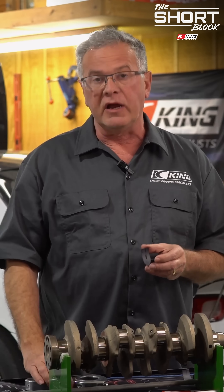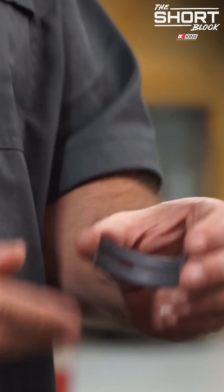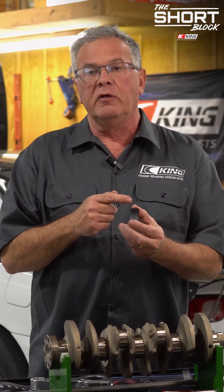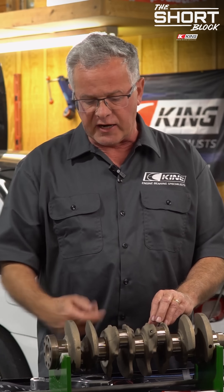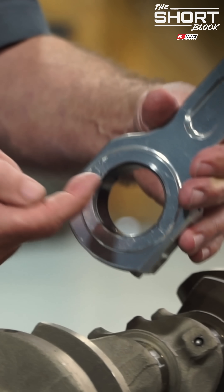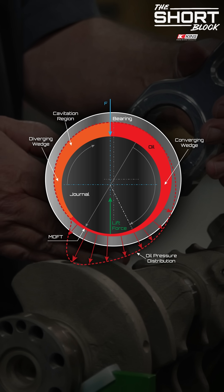The U-Groove is very effective in creating film pressure on the connecting rods. The U-Groove goes against the crankshaft, and as the oil comes in, it feeds the oil hole into the crankshaft. The time that it will connect the oil groove to the crankshaft main is the length of the groove on the bearing. So as it's getting oil from this groove, it's feeding through the crankshaft to create a film pressure on the connecting rod. This oil that comes in here is what's creating the hydrodynamic wedge that keeps the connecting rod separate from the crankshaft.